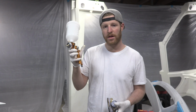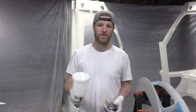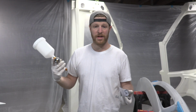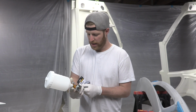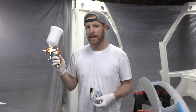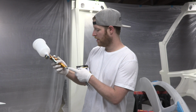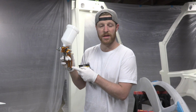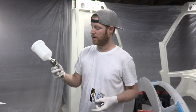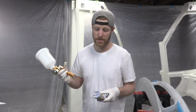And this is especially a low pressure one that they make because I have a dinky air compressor that you guys have seen in the painting videos from before. Somehow that thing still works, it's still running well, even though I left it outside for a winter. That air compressor is 2.5 horsepower. This gun would like about 3 horsepower. But it's all about the air pressure. The air pressure at the inlet is 15 to 19 psi. That's what we've got to get consistent, and then it will have about 10 psi out, and hopefully that'll get good atomization. And you just have to try and spray with these guns to find out.